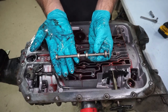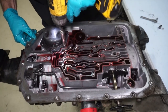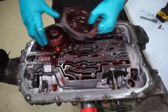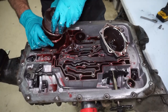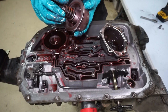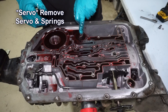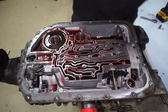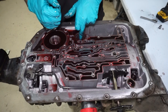So this is your manual valve for your gear selector — just pull that out of the valve body and we'll put it into the new valve body. Go ahead and get the reverse servo off right away. Then the intermediate piston is not going to be used; this isn't going to have engine braking. So the intermediate piston and spring can come out — that's not going to go back in when we do the trans brake. That piston or servo will actually push on the intermediate band inside the transmission, so that can come out.